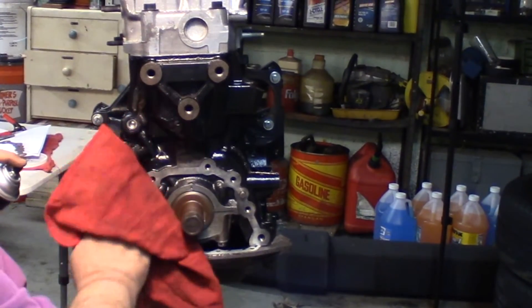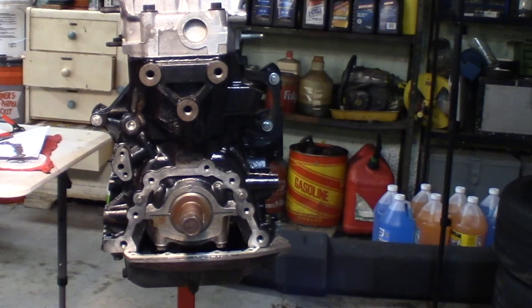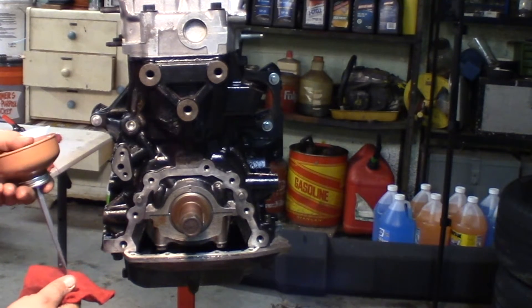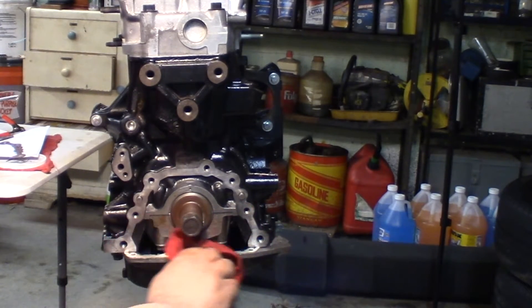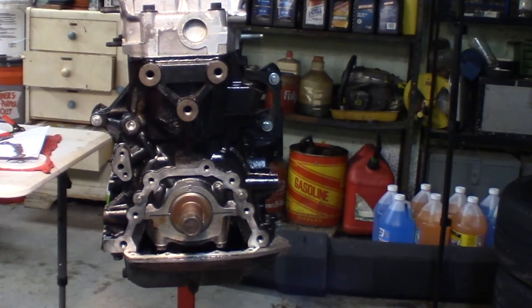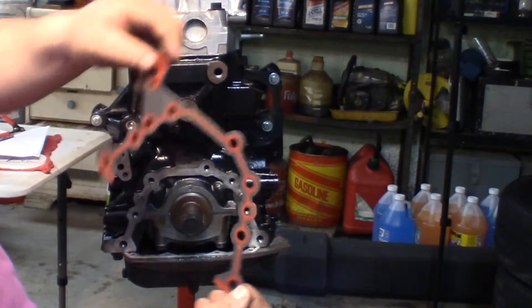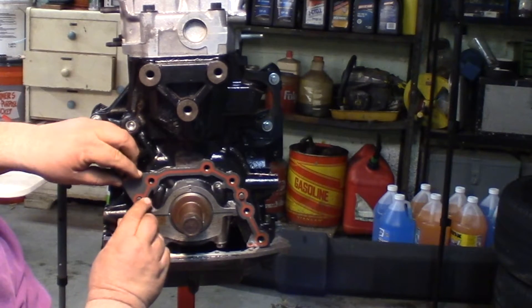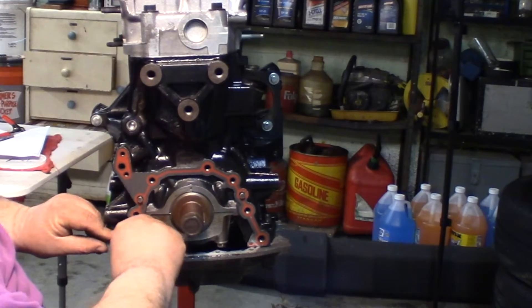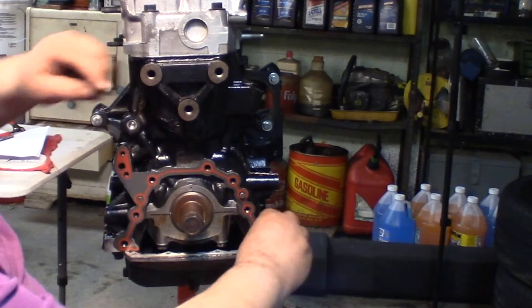All right, so I'm just going to go over this little bit here and we're ready to go. This gasket where the oil pan is has a little piece of rubber, and since the oil pan's on, it's going to fit kind of tight there. So I'm just going to get a little bit of oil on our shop rag and just lightly oil that rubber gasket to help this piece slide over top of it without damaging the timing cover. Now we're ready to put on our gasket — it's going to slide around that dowel pin there and this dowel pin here. It's going to fit really tight on the bottom, and that's how you want it. You want it pushed down into that corner.